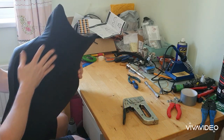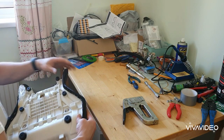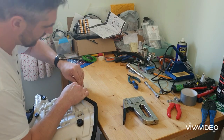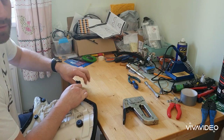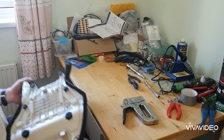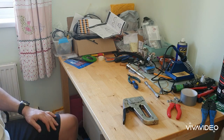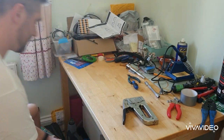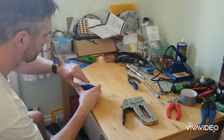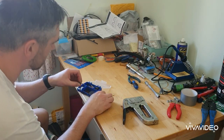The issue I'm having here is I'm using 10mm staples, and to try and pull this bit in, this plastic at the front is very thin, and the staples, I can feel them the other side, so I don't want to be using those. So I'm probably going to have to bastardise some of the 10mm. We'll see how that goes with Mr. Dremel and my steel cutting disc.